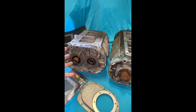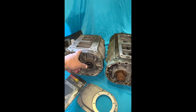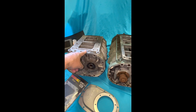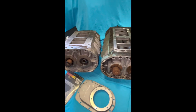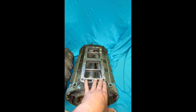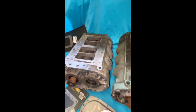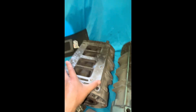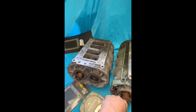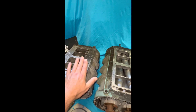If you want to do a more serious and reliable supercharged build, you're better off trying to find the V92 series end plates and running them on your 71. You can also run the whole V92 case, but it's got that large wide pad on top. I prefer the V71-style top with the normal bolt pattern — you just make up a carb adapter. That wide pad on top is how you identify the V92 series: if the case top looks wide like that, it's a V92; if it's got the standard narrow pattern, it's a V71.